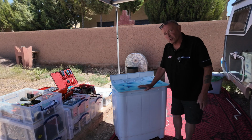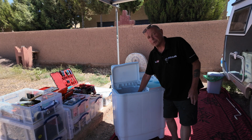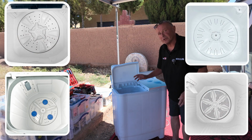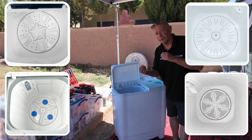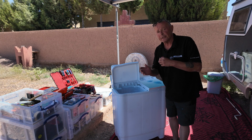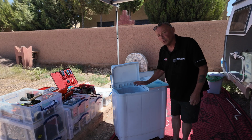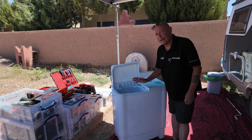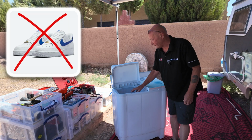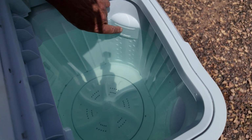When it comes to the wash functionality of this machine, there is a wash plate, sometimes known as an agitator or pulsator, at the bottom of the drum. This is designed to stir the water in one direction and then stir the water in the other direction, moving the clothing so it agitates correctly. Too much load in the machine will cause damage to the gearbox or the actual wash plate over a period of time. Make sure you fill the machine to the correct level of water.